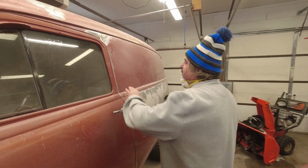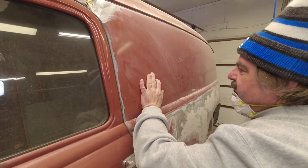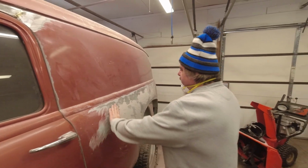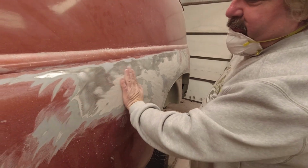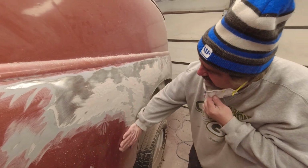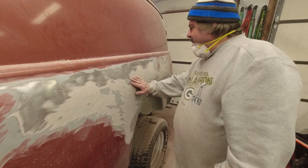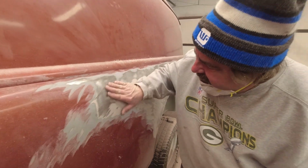Now it's just going to be DAing it and taking it back and find out where the putty is and see little parts of the paint that just didn't stick and just bubbled and popped. It's going to be all taken down. They had this part here actually built way too high. That's why it looks so ripply. God, I've knocked over 1/2 inch off this. It's a heck of a lot closer than what it would be. We just got to finish knocking it back and making sure there's nothing underneath this putty, because some of it's got rust that has popped underneath, and that's why it's popping.